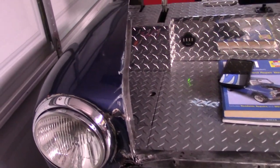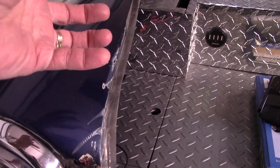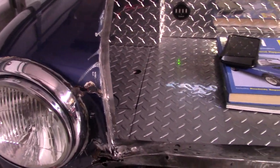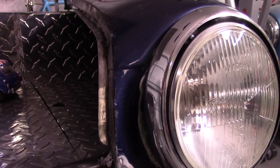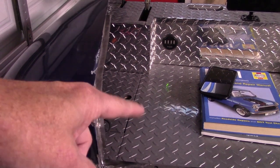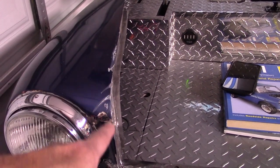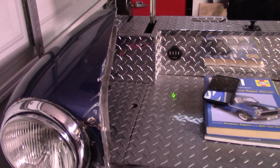Detail one: these lips on the wings. The original lips were all gnarly — holes, rust, sharp edges — so I cut them off completely and remade them. There's one on each side; I rounded the edges because I didn't want any sharp points. When the bonnet is down, I didn't want it to be straight-through visible to the work area. I had to weld them back on and form the metal to match the curvature and contour of the wing. I'm proud of that work.